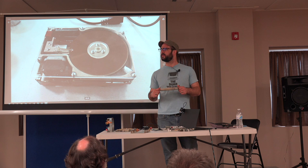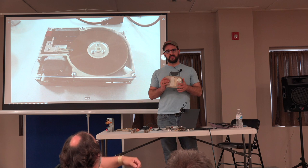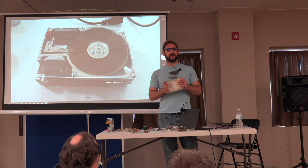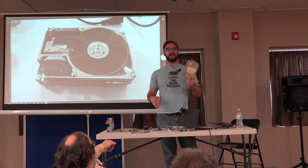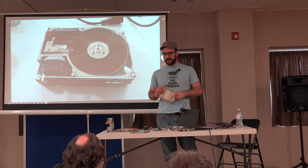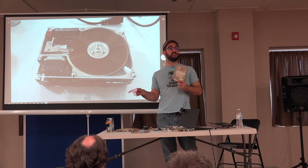But the drives were the same, I guess. Well, that's why they started the R drives. They were made on the same line from the same parts. In factories, they do batch test quality checking. So the really extra shiny drives get the little R on the end of them, and the ones that work pretty good became the regular drives. What I read about some people doing, where they were really concerned about reliability, was getting the RLL certified drive and using it on an ST506 controller. Now you've got the really good drive and you're not working it very hard.